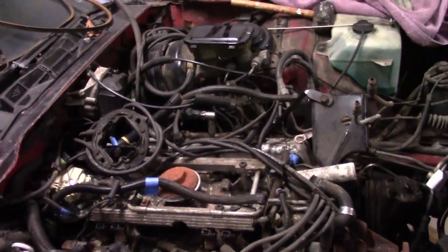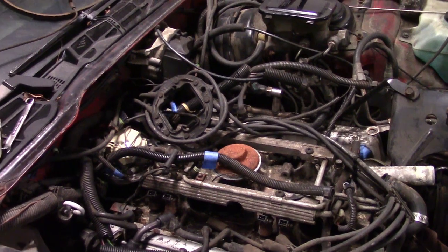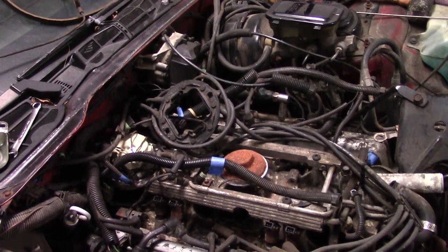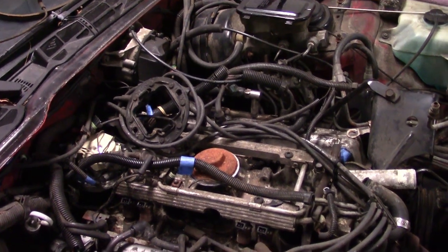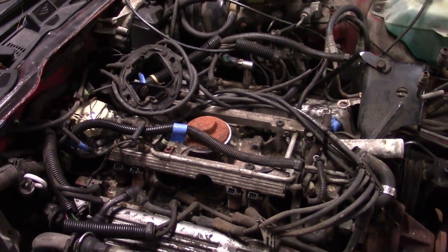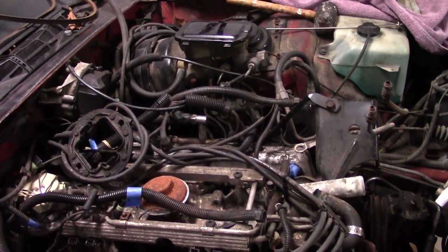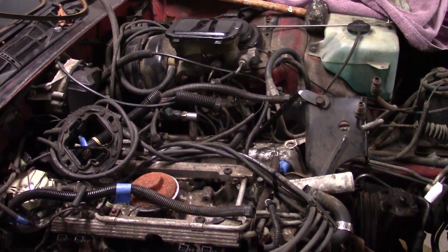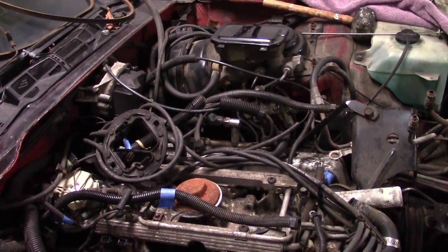The car right now is elevated. I've got it jacked up. I've been underneath and disconnected the exhaust and the torque converter bolts and starter connections. So the underside is in pretty good shape and all the cables that I needed to get are disconnected. So it's getting rather close. About all I have left are the engine mount through bolts and the bell housing bolts.